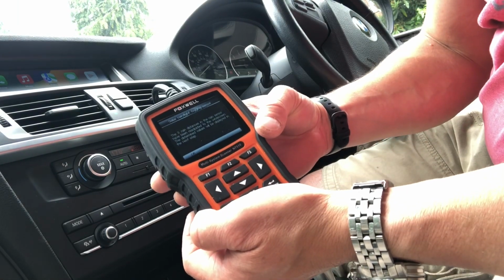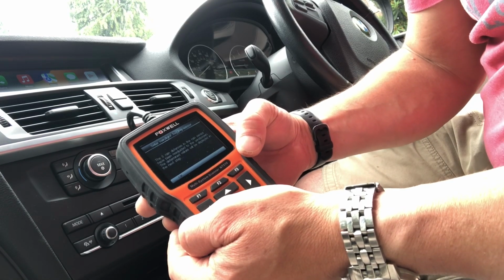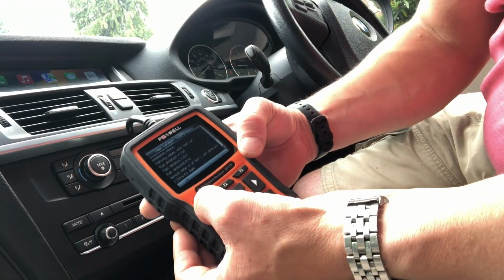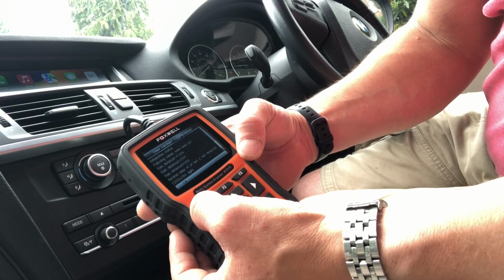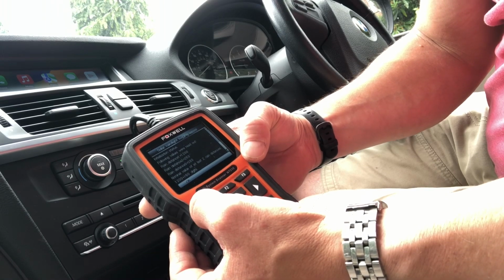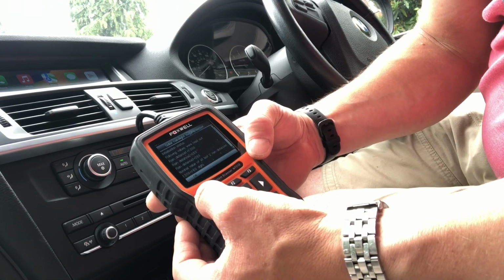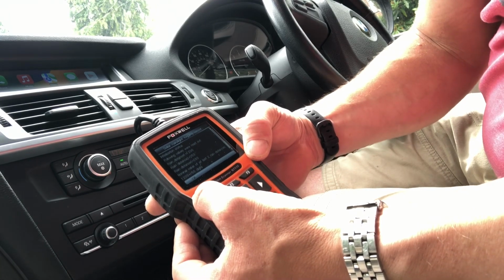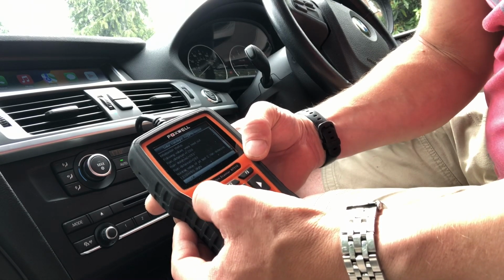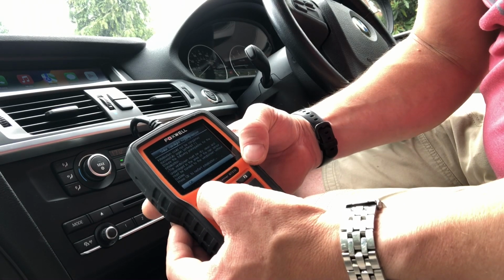Establishing connection. The 3 rain distances in the rain sensor have been readjusted to the windscreen. The determined values will be displayed in the next step. Okay, that's very exciting. So, following values were read out. Rain distance 1 equals 1200. Rain distance 2 equals 253. Rain distance 3 is 283. I'm not sure what these units are. Nominal value of at least 2 rain distances 1200 plus or minus 50 digits, whatever the digits are. Well, that's very exciting. Hopefully I can find out what that means.